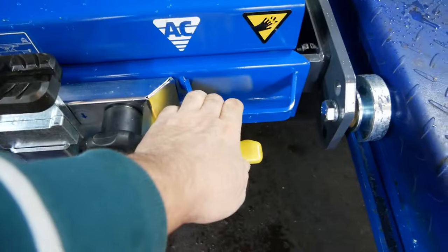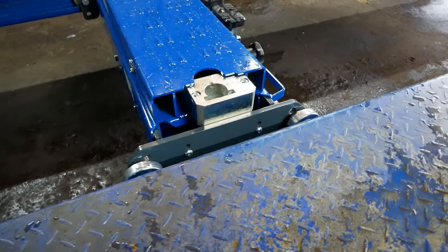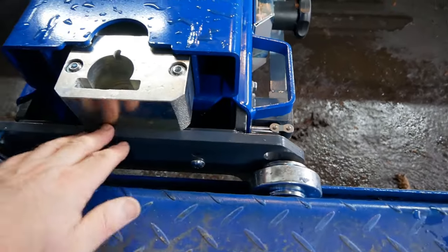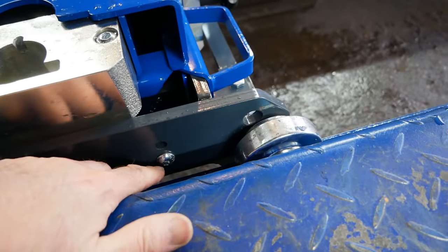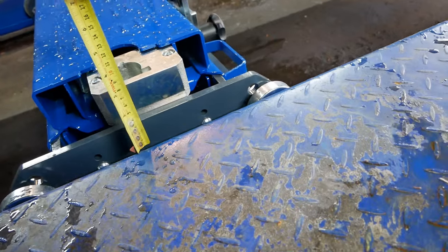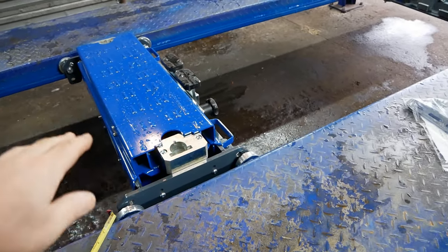You've also got these two grab handles to move it backwards and forwards — they're nice and big. Its closed height is 190mm, but that can vary depending on how you mount the wheels and the support arms. There are four different mounting holes for the wheels, and two heights for the bolts mounting the support arm to the jacking beam itself. In my case we're only looking at 70 to 75mm height above the lift, which is plenty low enough for even the lowest vehicle.